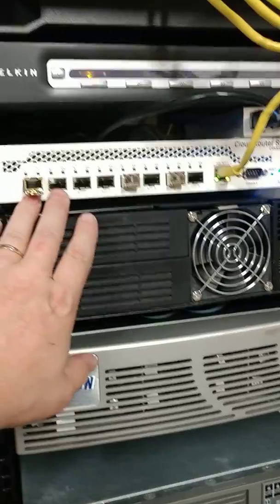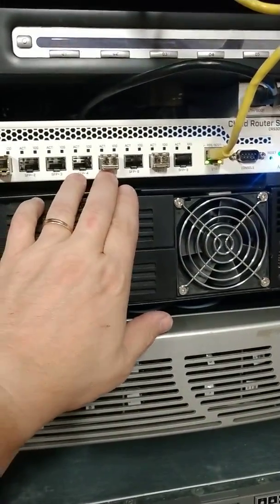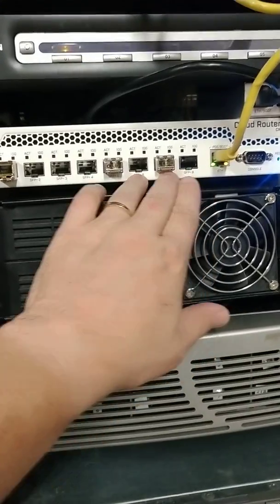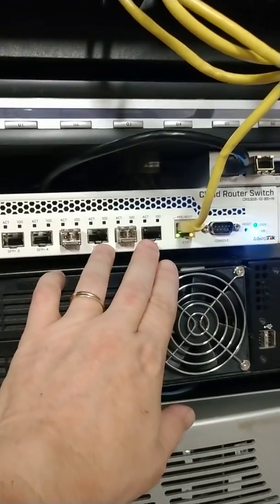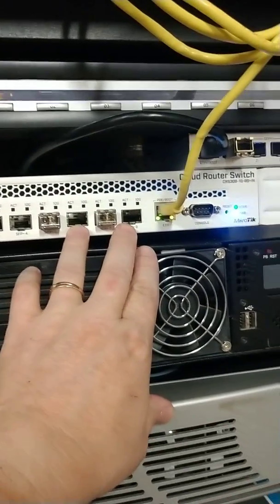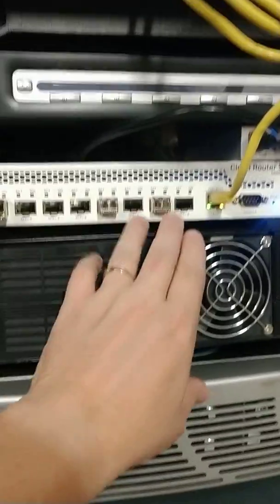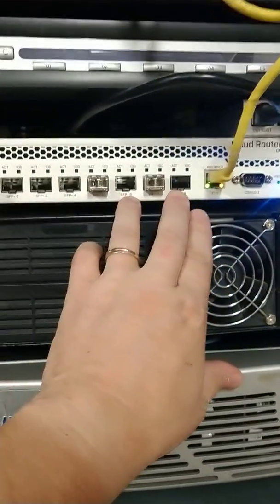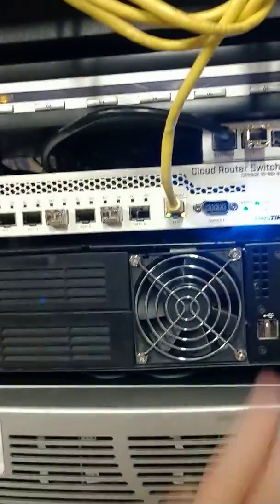You're going to need two ports for your interfaces — your desktop and your server. For my FAS3270, I need four fiber connections. That only leaves me three to play with if I want to bring on board an isolated NAS or some type of paired storage solution, or more servers like a web platform with a database. Databases always need to run faster than your outbound connectivity — 10 gigs is the way to go. By connecting port A to port 1, I get three more ports out of that equation.